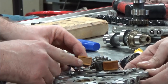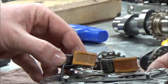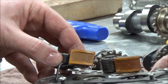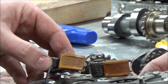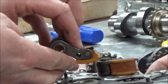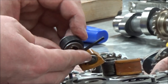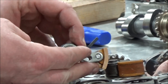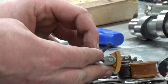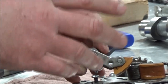See those deep channels or grooves in there? If you've been around any of the metric motorcycles, there are cam chain guides — they're usually shouldered like that on the side. I'll go ahead and put this one on its side so you'll see why. There's not much material there and it has quite a bit of force on it. Look at the heavy gauge of this spring that's holding tension on that chain. So these will obviously wear and they're a service item that needs to be replaced per the service manual and mileage specifications.